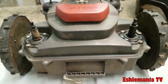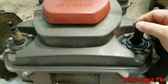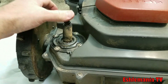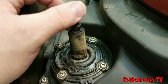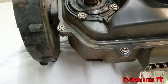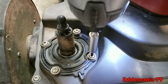So that was some antique footage. Now that we've got the body off of this mower, what we want to do is wiggle each joystick sensor around and see if we can tell a difference between the two. If one sticks a bit or one's real floppy, that gives you an indication as to which one might be the problem. As you can see, this one here tends to stick a little bit — there's definitely a big difference between this one and the other one.